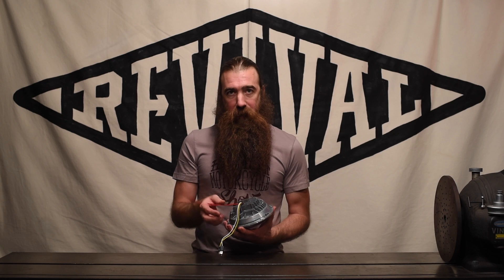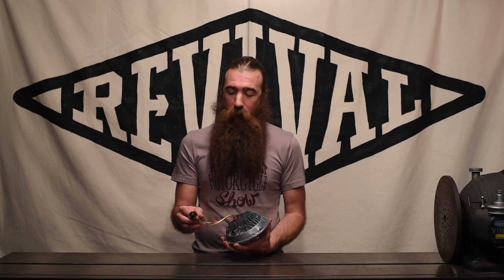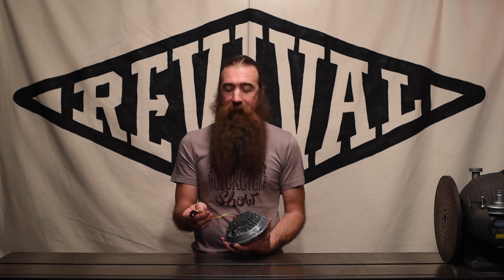This does also come with a red wire. The red wire gets connected to a daytime running light, pilot light, or parking light depending on what the regulations are in your area — just a low-power front marking light for places that require it. As far as I'm concerned, you don't really need that. I'm good with just a standard low beam, but some people like to have it, and it's there if you want it.